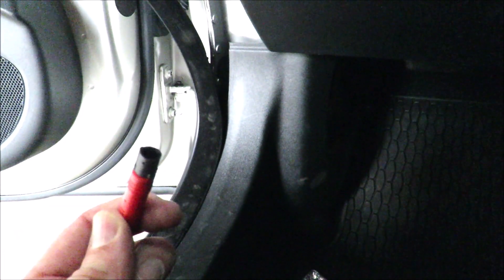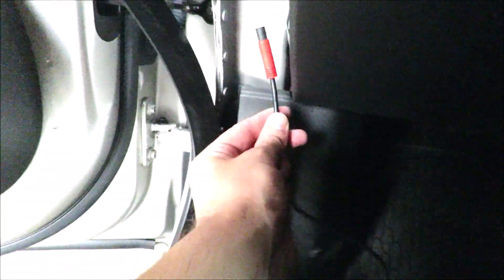I just want to give you a little tip. This is the power cable that's going to plug in up there by the camera. You don't want to be running all these wires through this hole over there to get to your fuse box in there. What you should do is run the cable from your fuse box to begin with out here, and then pull it to the top and then around your airbag. I have the power cable plugged in and I've tucked it inside the hood lining over there. I've run it all along here and it comes out over there — you can see it running there — and it's going behind the airbag. So if the airbag ever pops, it's not going to rip the cable down. I've got the cable running all the way down there, in through that hole, and then out by the fuse box.